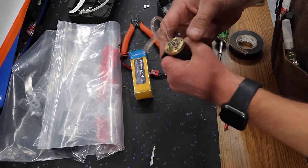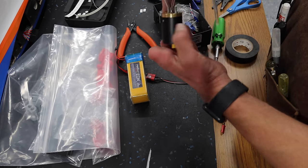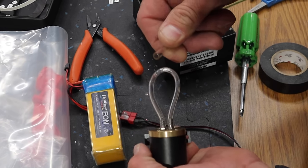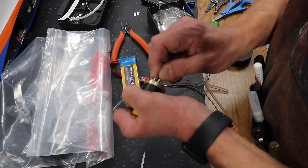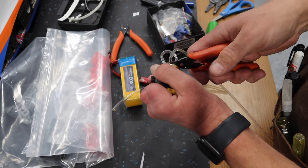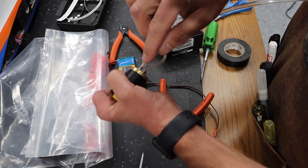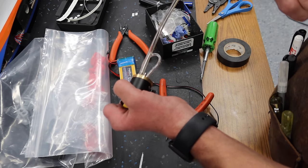Okay, so this tip revolves around fuel pumps. I'm getting ready to install the fuel pump, and we've got a 4 mil nipple on these guys. Our intake is gonna be a 6 mil line going to the UAT. My 6 mil line obviously doesn't fit over top. So the simple solution: we take a little section of 4 millimeter, making sure we're on the intake side of the pump, and install it over top of the nipple. Then we clip that off. Now we can put our 6 mil over top and safety wire that. And that is how you attach 6 mil to a 4 mil nipple.